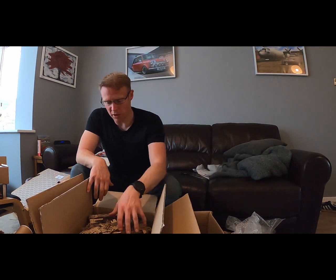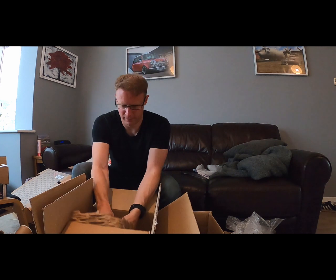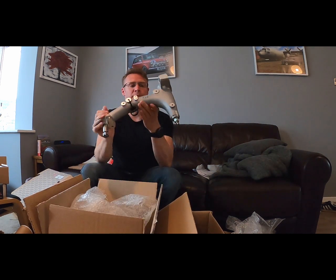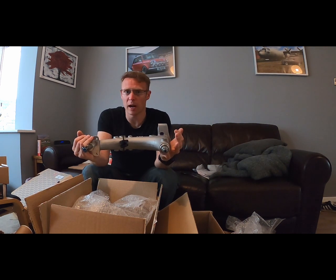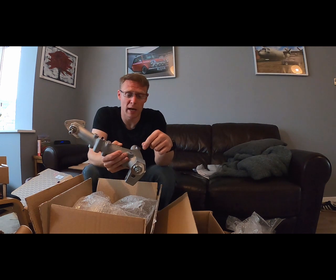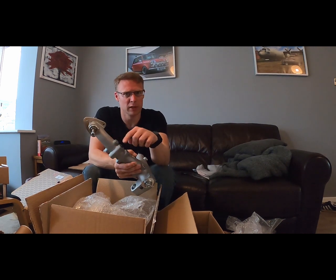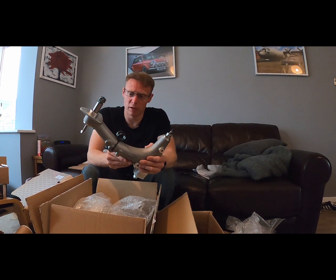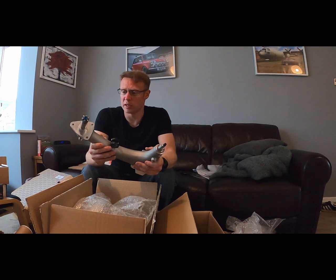With the theme of more aluminium stuff, the aluminium trailing arm. These need a bit of work to fit to a standard car, but we're talking absolutely minor work. But as you can probably see, they don't have the bracket for the pipe that goes to the back. I am going to replace it with the one-piece braided line, so negate the reason to have the copper brake line at the back. Reason for this, mine have started to go a little bit rusty already, but I'm super pleased with these. I'll probably put a couple of coats of lacquer on them just to stop any surface corrosion.